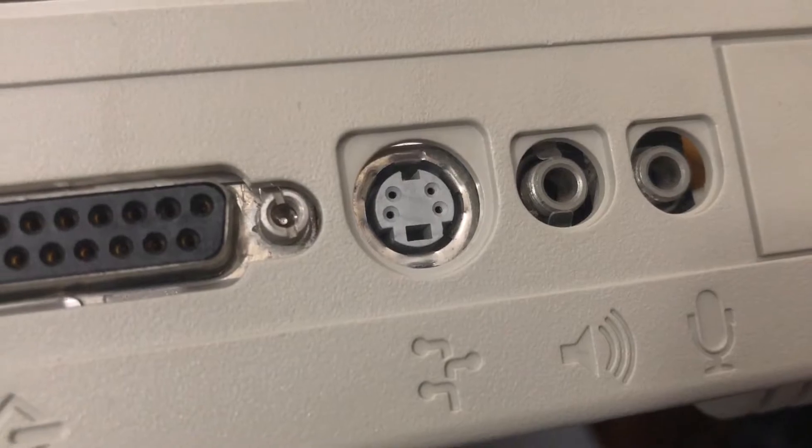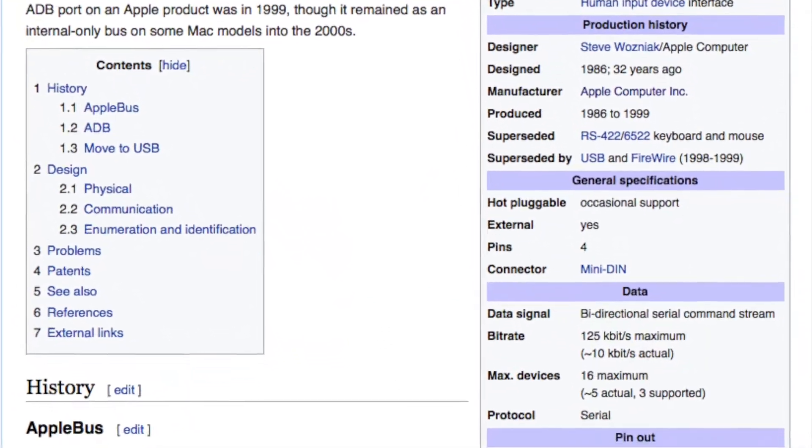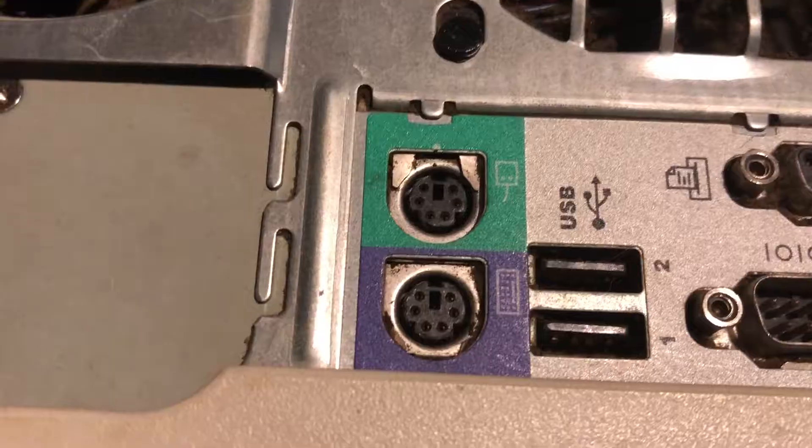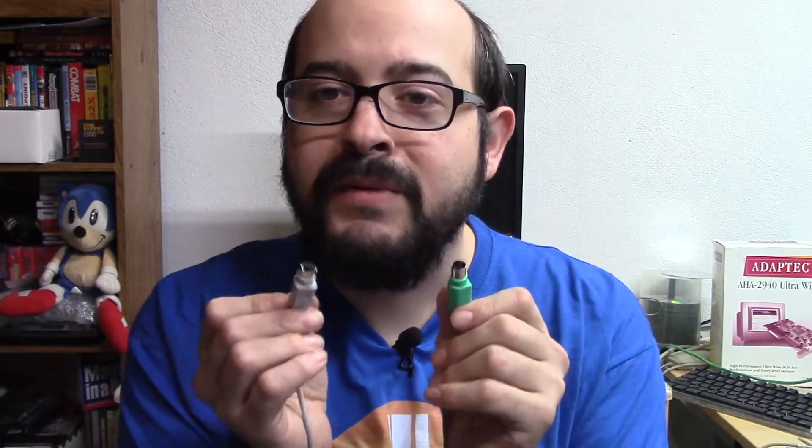If you've only used a mouse provided by Apple you may be missing out. Over the years I've collected an array of Macintosh-compatible mice — some very unique in their approach and some rather simple. All of Apple's computers throughout the 1990s used the proprietary ADB or Apple Desktop Bus port for connecting keyboards and mice. Although similarly looking to the PS/2 port on a Windows computer, they are not compatible or interchangeable. Before USB it was pretty easy to mix up an ADB connector and a PC PS/2 connector, as they're both little mini-DIN ports that look pretty similar to the common individual.